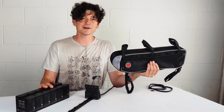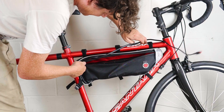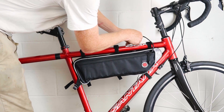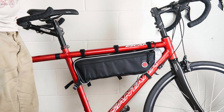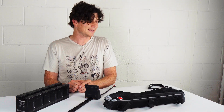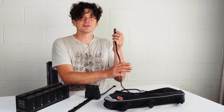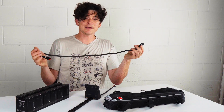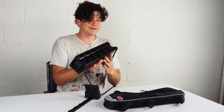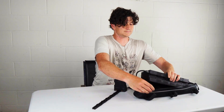In this case we have a Banjo Brothers frame bag and the length and height of this allows us to fit up to seven LIGO modules just hanging neatly from the down tube. One of the key advantages of using a soft bag like this is that the battery is concealed inside normal bicycle hardware so it doesn't look like an e-bike battery is present on the bike. In order to wire this up you simply need to have a cable that terminates with an XT60 connector to match the LIGO battery, and at the other end is terminated to match your motor controller.